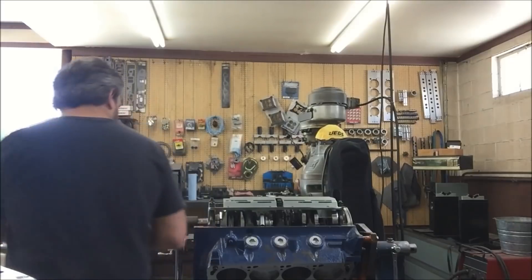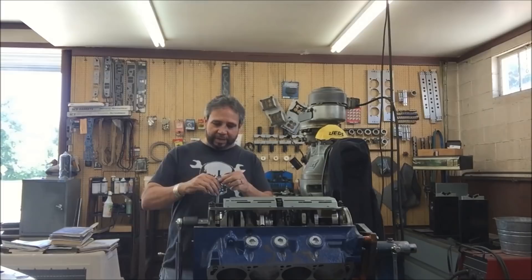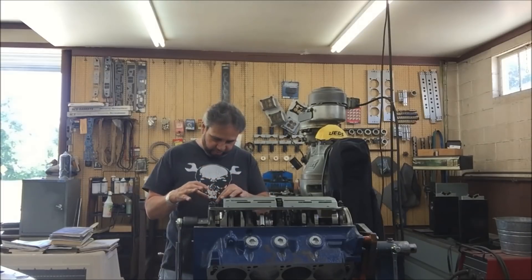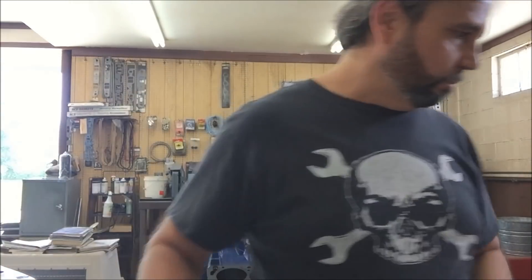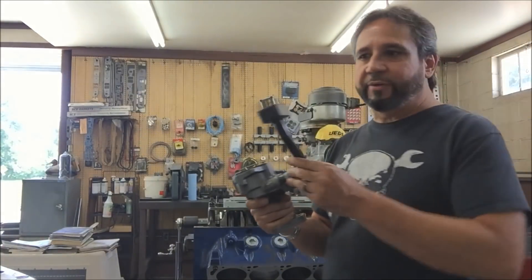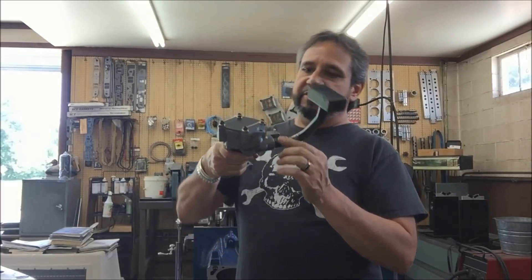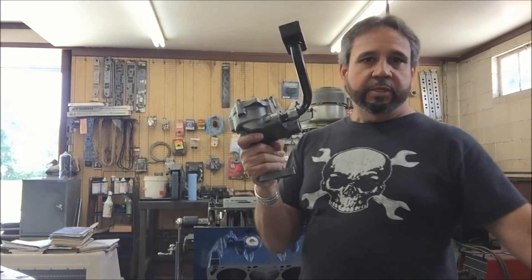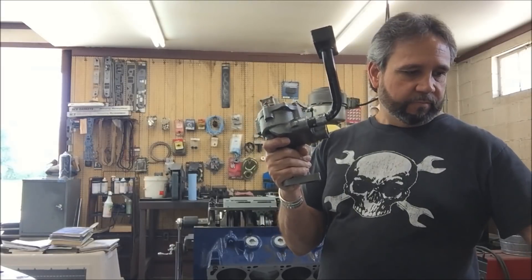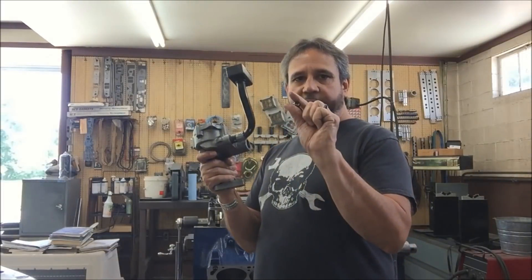I like to put a little bit of oil on the drive shaft. We know it's got the collar on it — so if you pull the distributor, you're not pulling out the oil pump drive shaft. Make sure you put the collar down. Here's my pump. That's a nine-quart pan that I use, so the pickup's pretty big. Here's his oil pump — safety wired. I'm not going to mess with it. He told me it was golden. Grab the bolts — they have 12-point nuts.